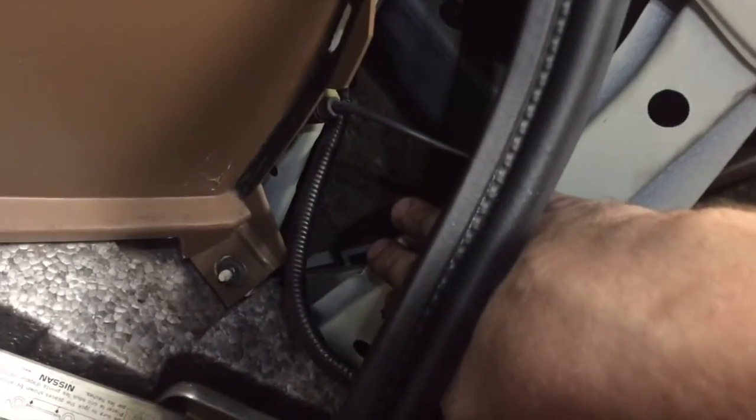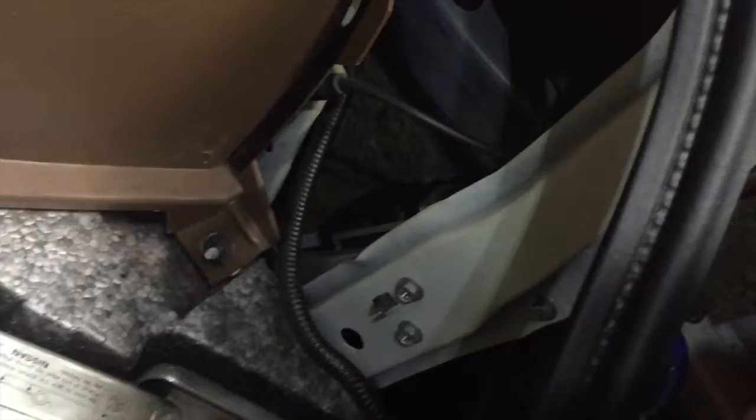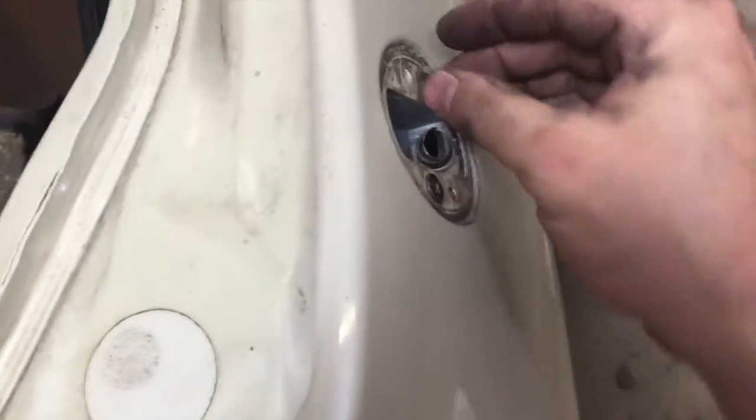Keep these screws screwed back in because pretty much this antenna cable connects to right there. You don't need to remove the motor because it's a pain and I have no clue how to do it, but you just literally have to cover this up, make it look nice and flush. Radio will still work. I have done this before, so no problems with that. The only thing you could do is disconnect the motor that goes up and down for the antenna.